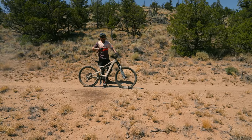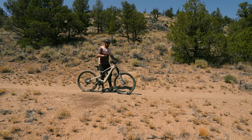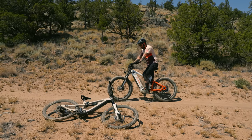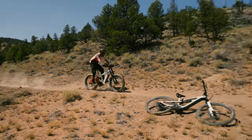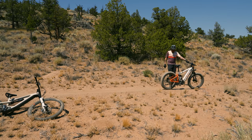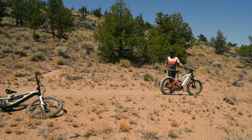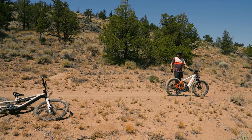I was just over 20 miles an hour and stopped pretty quickly, trying to do as little skidding as possible and really relying on that front brake. We've marked where the Fezari stopped, and I'll enter at the same speed on the CyRusher. At 24 mph this thing is very sketchy. That was as hard as I could brake. Small rotors, single-piston calipers, and probably a hard brake pad compound, plus 29 extra pounds — there are a lot of reasons why this took two extra bike lengths to stop. Braking distance points to the Fezari.